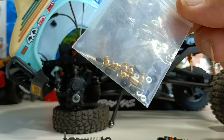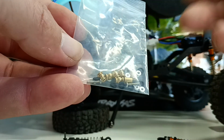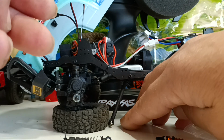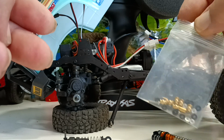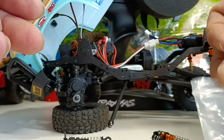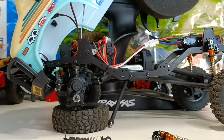But basically, for doing the job, you're going to need to drill 6 of these out for the front and 6 out for the back. Okay, we will be replacing the ball that's on here. We're going to remove this and we'll be putting one of these in, which can be quite difficult because the link is quite thick, but it is doable because I've done it on the back. Okay, guys? So let's get stuck in at doing this conversion.